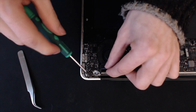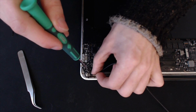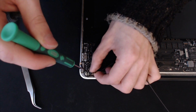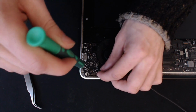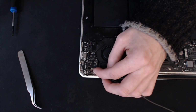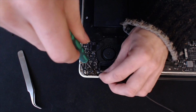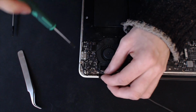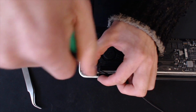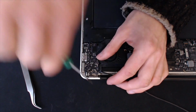And now the wireless antennas, these come around and sit there. And we just need to make sure that those cables just tuck under that I/O board out of the way. And that little clamp just sits just under the board as well. I'm just going to bring in the other screws just to help guide it into place. Like that. That thread feels like it's crossing. I'm just going to have to put my hand in the way. There we go.